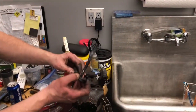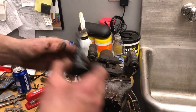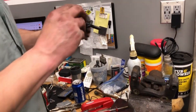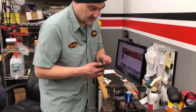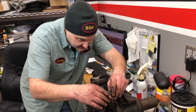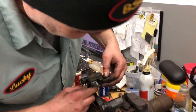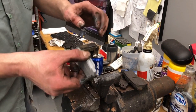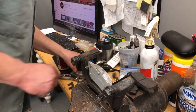You wanna put some grease right here where the stainless slides are gonna go. The other thing you wanna do is get some grease on these pins. Because if these corrode, it's gonna cause premature failure of your brakes — that's kind of what happened here, these were seized up a little bit. Grease it up nice, put it on. These little brackets go on here, just give it a little click.